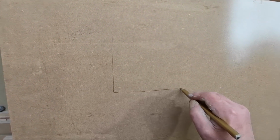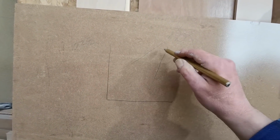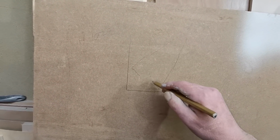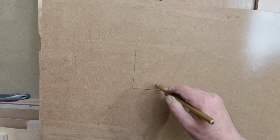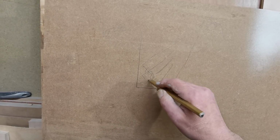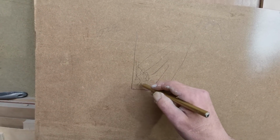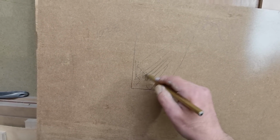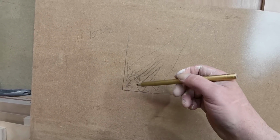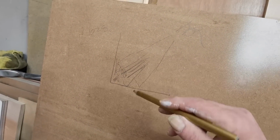Imagine that's your corner and your spray pan is there, this is your gun here. Your spray pattern's coming down, hits there and bounces off. Same there, comes down, bounces off. So what you end up with is turbulence in there, so this paint that's coming down the middle doesn't reach the corner. So what you end up with is paint down to about there and a gap in the corner. So if you reduce your fan down to just a few inches, you can squirt it down into there. But it's quite hard sometimes because you get too much paint, you've got to turn down your flow and your air and everything and just take it gently.